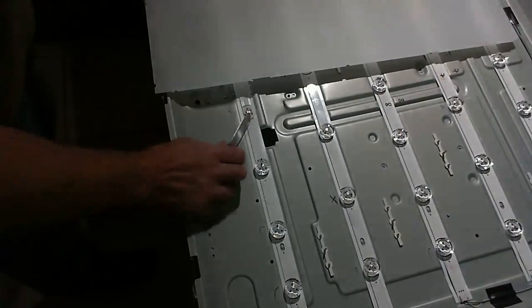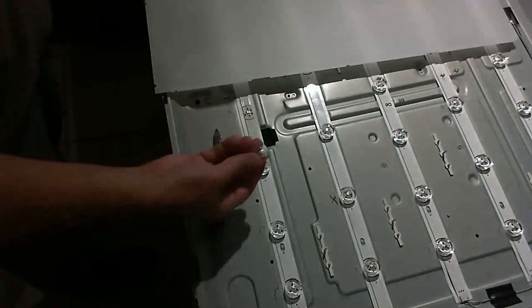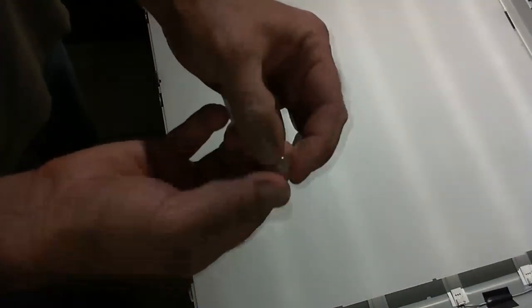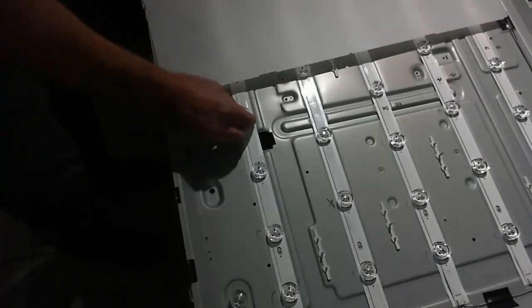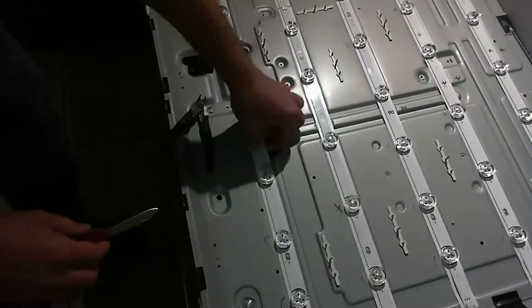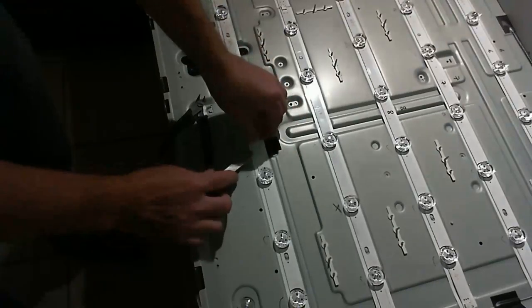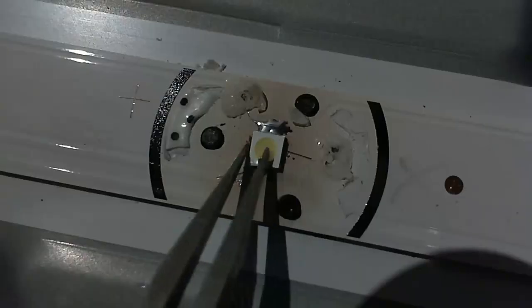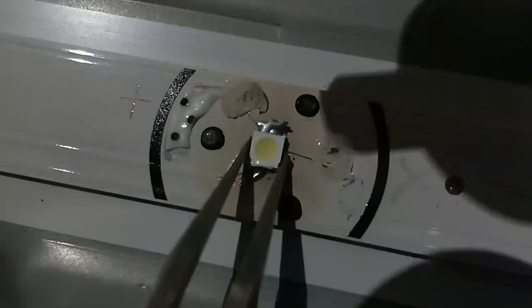I break the one off that I had mounted on the LED and I'm just going to try it here, just to demonstrate how it will not work — with another little lens I have from another TV. And it's absolutely not the same thing as you can see. Also, if you wanted to replace the whole LED strip, you can see it's very difficult too because they are glued with some double-sided tape.